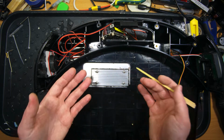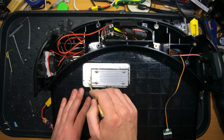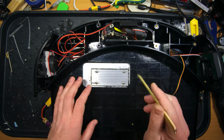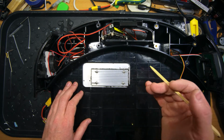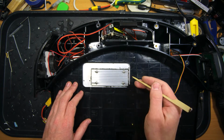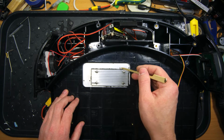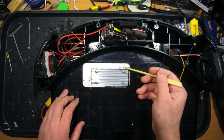And to avoid spoiling the thermal paste, I've covered all the bolts which are here, here and here with special lacquer to protect them from corrosion. And of course all the bolts are screwed in with thread locker, which will definitely make sure that no water or road reagents will seep in through the thread of those bolts and go to the other side where the controller board is located.